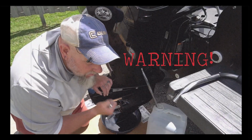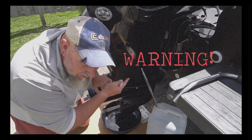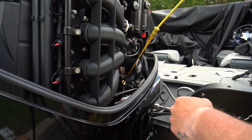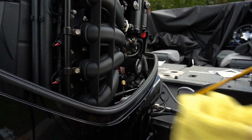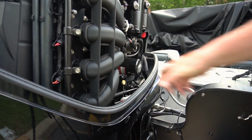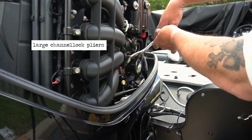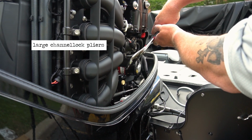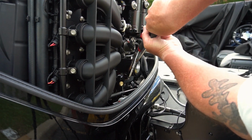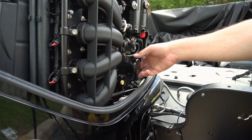If you loosen it too much or remove it by accident, you are going to break the seal that's in there, and then you're going to have to take your motor in. Now I can remove this dipstick and get that out of the way. And I'm going to loosen my oil filter here, but it's a little tight, so I grab my channel locks. Oh, come on, Mama. Give it a little twist. There you go. Break that seal.